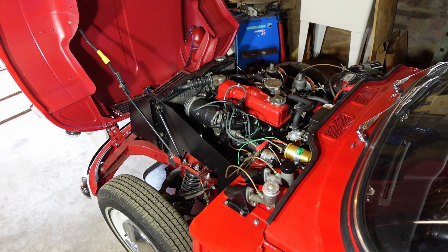When I was in high school, I had a '76 MG Midget that I bought for 300 bucks. Thing didn't run and I didn't know why. It had a Weber carb on it — halfway decent car, probably only about 10 years old when I bought it. I'd been taking auto mechanics courses at the time. It had a Piranha ignition — the way those work is there's a slotted disc with four slots, a little photo sensor cell, and a mirror with a laser that reflected light off the mirror. When the slot came in front of the mirror it'd fire, but some dust or debris collected on that mirror. I blew that thing off, put it back together, and it started right up and I drove it for the rest of my high school year.